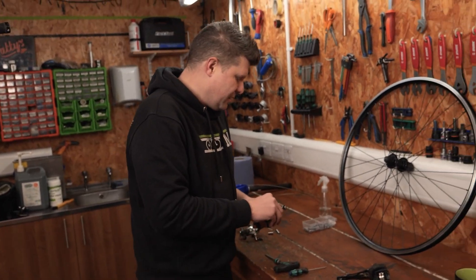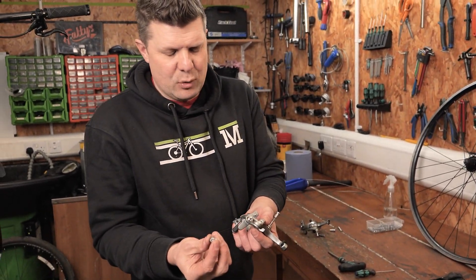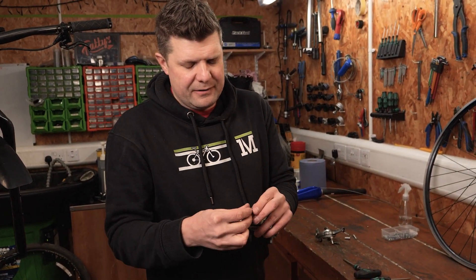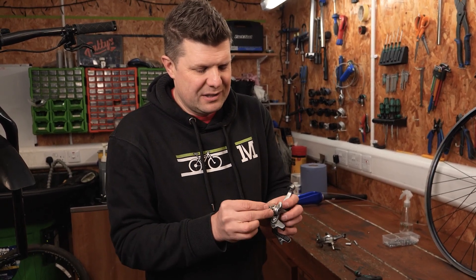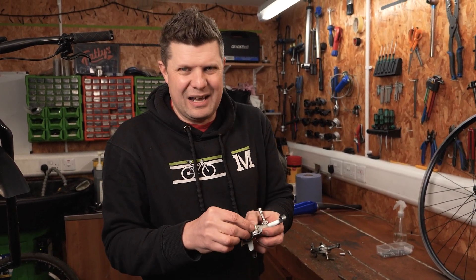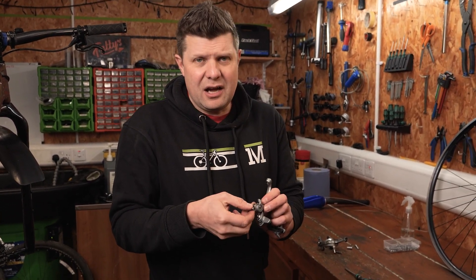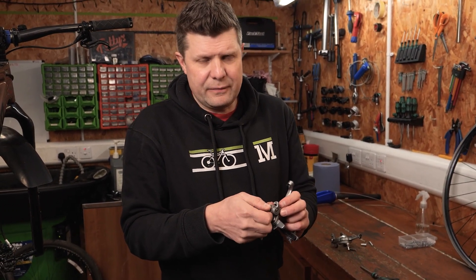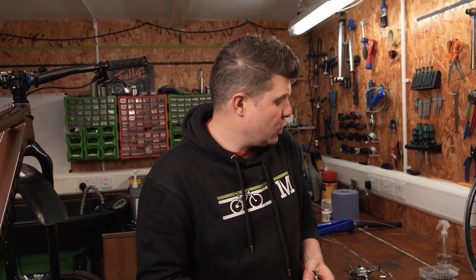The other thing we see is with the cable clamp bolt. These get stripped, and I can't tell you how many times people have swapped them out with an M5 bolt and washer, or got them the wrong way around, or most likely over-tightened them. Check your torque settings — you're just looking for one nice straight cable run through there at the correct torque and you should be good.